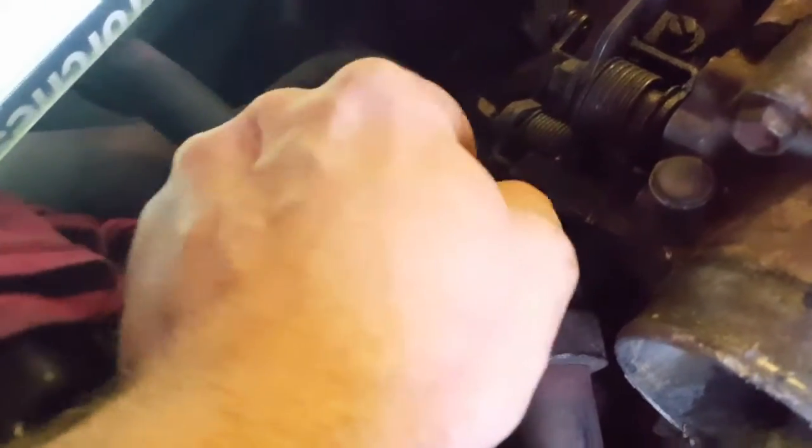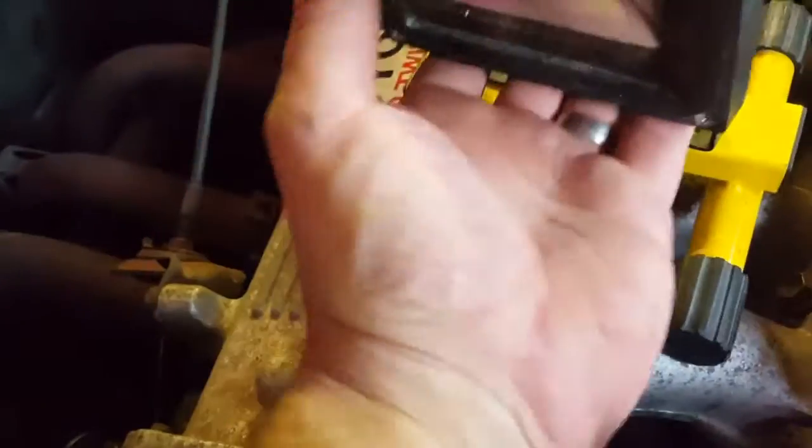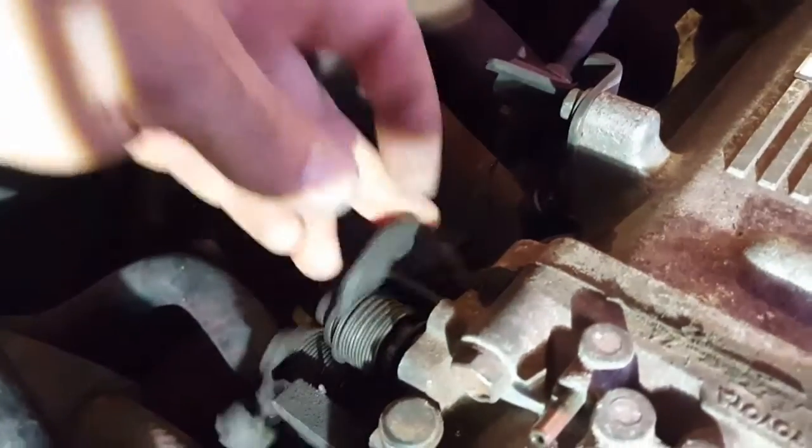I kind of need to get this throttle wire off and I can't figure out how to do it. I think the wire's held in here. I'll try and figure out a way of getting that out, and then I can unscrew it there. Hopefully I can shed a little bit more light on the situation. Let's have a good look at this. Does that pop out? Who knows? Right, I managed to get it out, but I noticed the cable's just a little bit frayed here. It's not breaking, but it will only get worse, won't it? So I have to look about maybe changing this throttle cable.